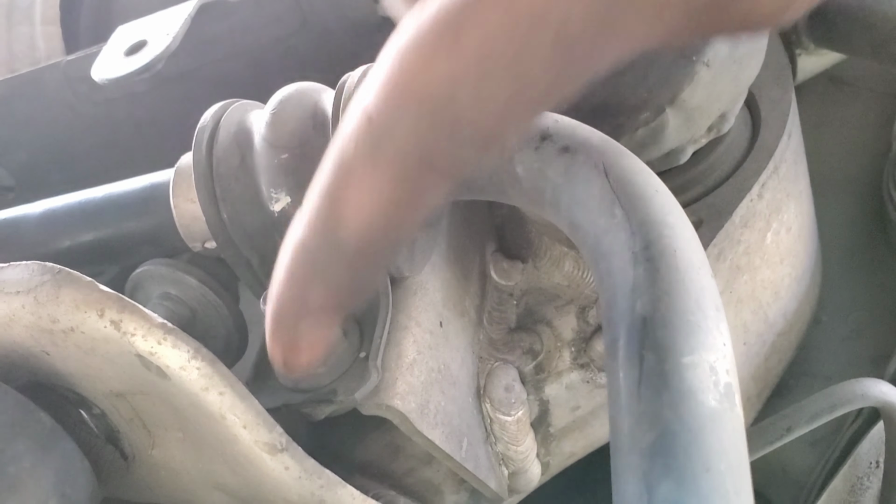Okay. I think you have to take off the camber arms in order to remove the traction arms, because the arm for the camber arm is blocking. All right, so if you can see here, this is my traction arm banging on the top of the camber arm. So I'm going to remove the camber arm again and hopefully the traction arm just slides straight down.